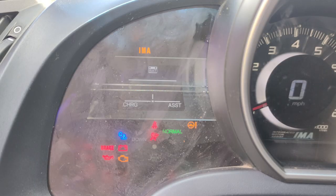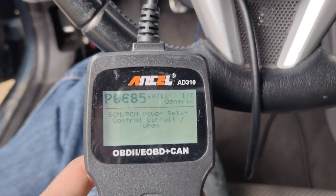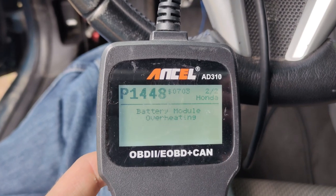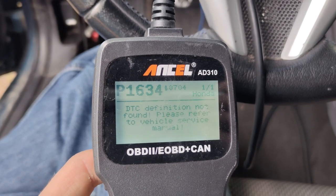This vehicle does not run and drive. It technically was drivable — we ended up trailering it three hours up here — but it's not in ideal shape for driving right now. The issue is these check engine light codes that we're getting. We get a check engine code P0685 for the power relay control circuit open. And after the engine has been running a while, we also get P1448 for the battery module overheating as well as the P1634 code for the drivetrain. This seems to be a fairly common issue with the CRZs, and these combinations of codes and lights tend to lead toward battery issues.